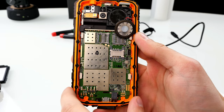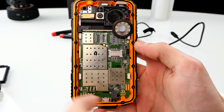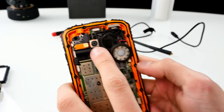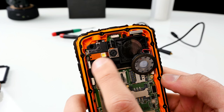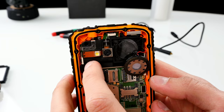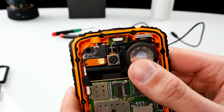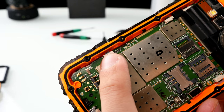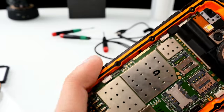I'll probably do the repair in the next video when I can get my soldering station. We have the battery contacts, we have the RF shield which I won't open up because I want to still have a working phone — everything should be as stock as possible. Here at the top we have the camera module and we have the LED flash which is kind of big, looks really massive actually. Then there's some huge plastic block and I guess that's somehow for the walkie-talkie function. The antenna is here — you can see some kind of golden contact for it. Here's the speaker, and all the buttons. Here are some buttons — normal buttons — then there is some rubber silicone seal, and on the outside there's another seal and the plastic hard button.